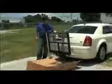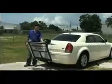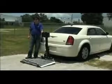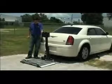Power the platform to a fully folded position and remove the box. Power the lift down to the ground. The platform should unfold smoothly. The end of the platform furthest from the bumper will contact the ground first. The lift will pivot on the hitch post, allowing the entire platform to rest evenly on the ground.